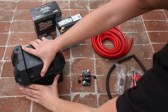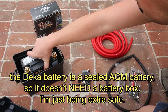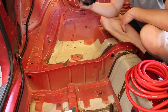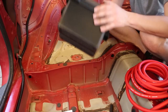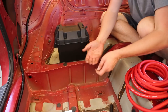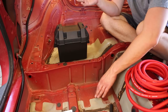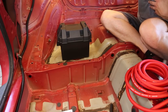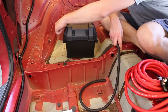We have our battery case here which is a smaller case than normal and our battery will fit right in there. I just have to make a little mounting bracket inside that bolts to the bottom of the chassis. As far as battery placement goes I've got a few different arrangements — one right here, one down on the floor, and one up by the PCM near all the other wiring. I decided to go right here because if I had put it down on the floor, the threaded rods that come up through the floor would actually be so low that if I went off track and hit the edge of the tarmac I might rip the threaded rod out of the floor. I just don't want any problems with my battery — it'll also be easily in reach if I need to get to it from outside the car.